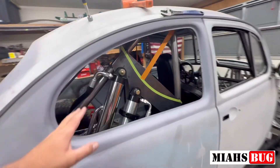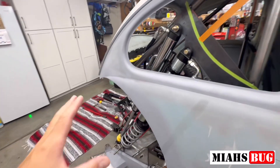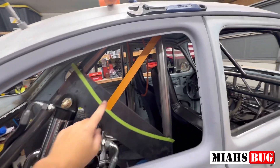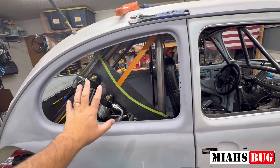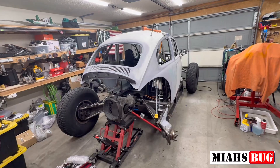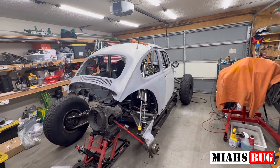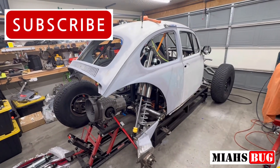For the top shock mounts I created a template and cut out an eighth-inch steel plate to get this mocked up so I can start swinging the rear suspension. I'll probably fab this up and make my own design - maybe something like a statement piece. I kind of like this curved look. I'll definitely add another tube support here to help distribute the load into the chassis, and I'll be making a separate video on how to build all this. Overall I'm very happy with 17 inches of travel - I could push it to 18 or 19 if I really wanted, but I think 17 is good for the initial first drives. The front can actually pull 24 inches of travel - I'll limit that out to probably around 20. If you like this content please like and subscribe and check out my website at mayasbugstore.com.